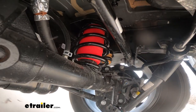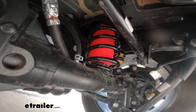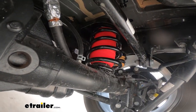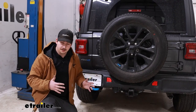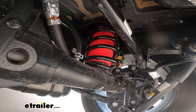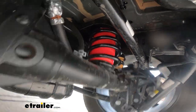After driving around with the airbags installed, they performed really well — even better than I was expecting. On the bumps course they made a pretty big difference. Before, with nothing installed, whenever we'd hit a bump we'd get a lot of aftershock and it would be really slow to correct itself. With the airbags, we'd hit a bump, feel the bump, and it would correct itself back to normal almost immediately. Each bump was a lot more defined — it could make the ride feel a bit more stiff, but I actually liked it because once it corrected itself, it was back to normal really quick.